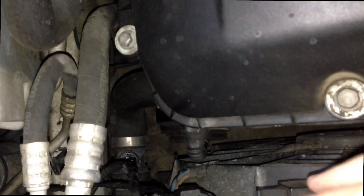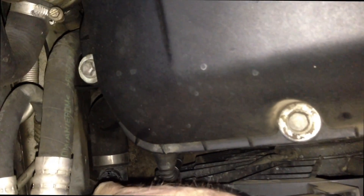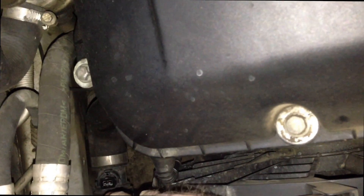So you go down in here — this is the coolant temperature sensor. We pull the electrical cord off, and now we just have this temp sensor right there. But we don't want to remove it yet. We want to go over to the coolant cap and let some air into the system first.